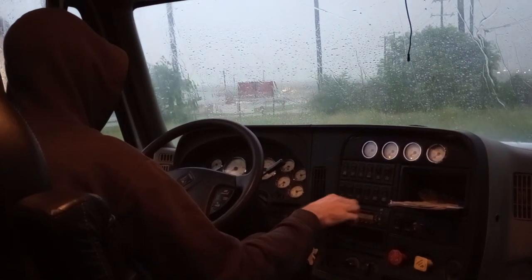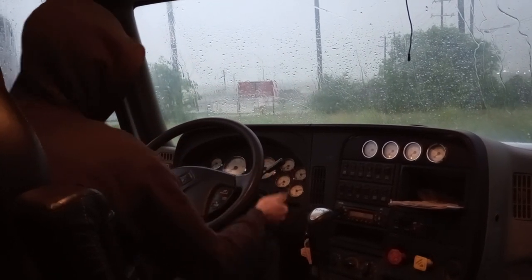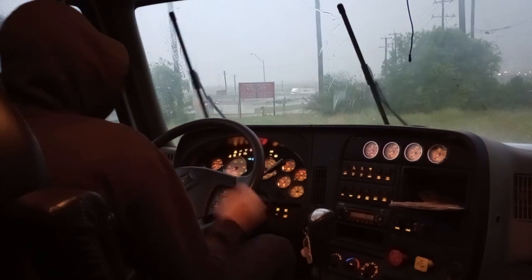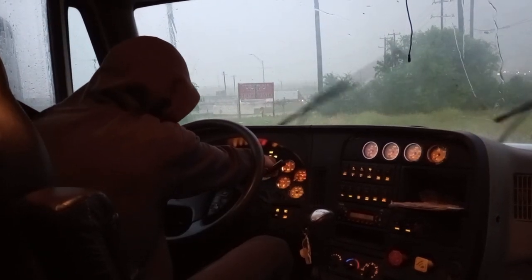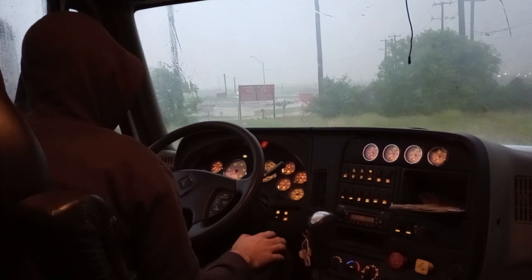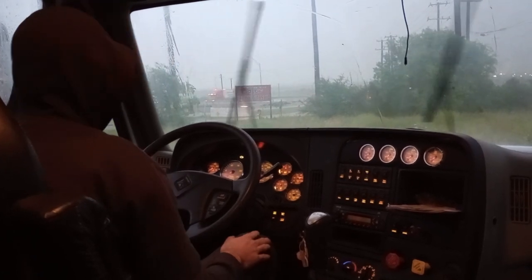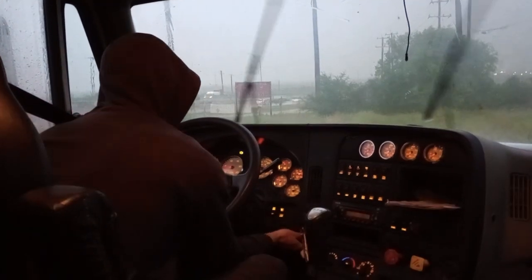I'd make sure that I'm in neutral. My brakes are engaged. I would go ahead and turn the key to the on position, and I would be checking to see my ABS light, to see if it's on, and it should turn off in a little bit. It turns off, so that indicates that my ABS system is working. And then after that, I would perform a safe start by engaging the clutch, turning the vehicle on, and disengaging